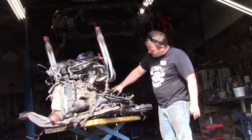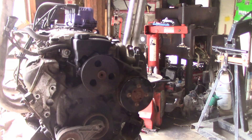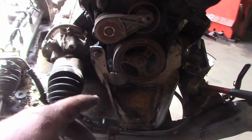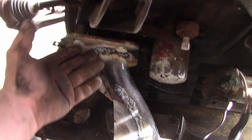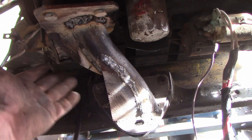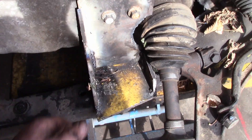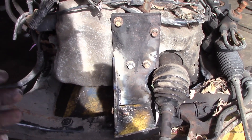What we got to do is build a bracket that comes off of here and comes around to here. Here's the issue — the promoters do not like this mount. They say that even though it uses the factory W body mount location, that is not a factory Toyota Camry location. So what they want me to do is build brackets that go to the factory Camry mount and mount up to the aluminum. This one right here is what I've done — I've made this mount. We have a couple of gussets to make sure it's not too bad and we can still get all the bolts off pretty easily. This one right here is not so bad because it does go to the factory Toyota Camry mount location — I just got to drill a hole and mount it.